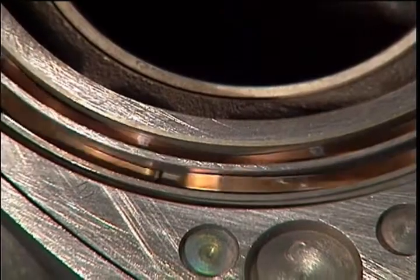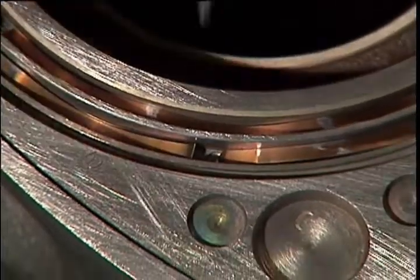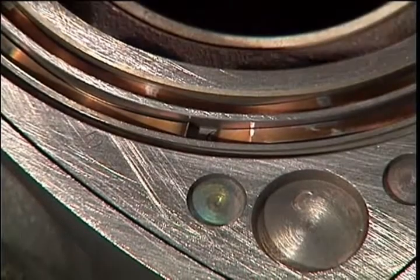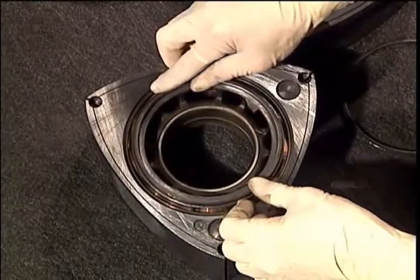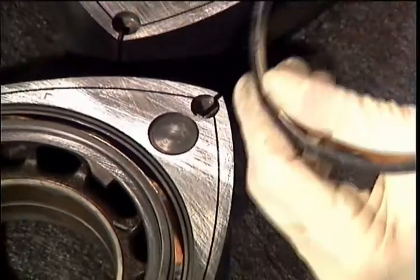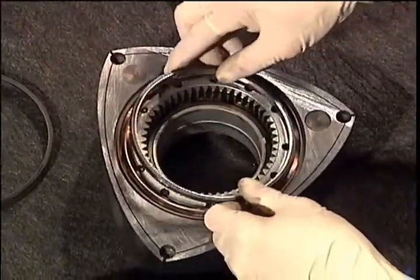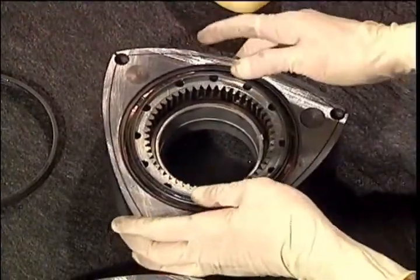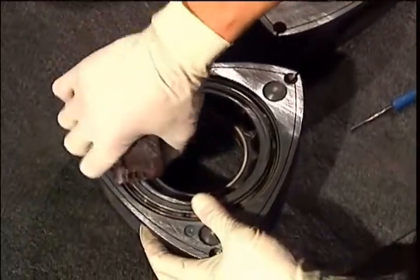Here is where the round tab on the spring should be placed. There are 2 round depressions on each rotor. Choose one. There are 2 square notches in the back side of each oil ring. One notch must line up directly with the square tab on each oil ring spring. As you did with the front face, press down carefully until each oil ring seats.